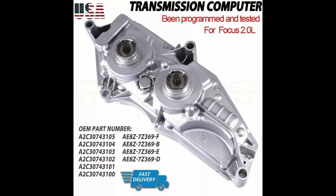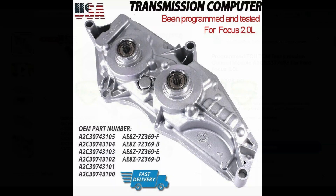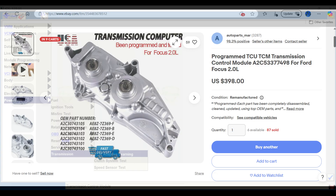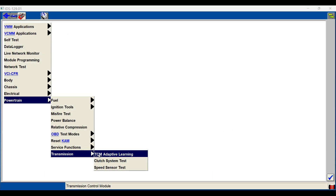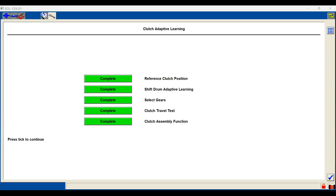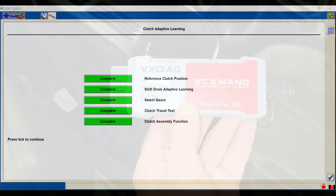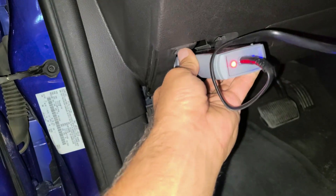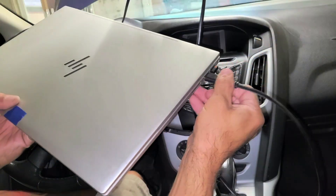To start with, I would recommend purchasing a TCM that has been pre-flashed with Ford Focus software, which will save you a lot of time and headaches. In some applications, you may be able to just purchase one of these TCMs and it might just work as it should after installing it. But with my car, it did not shift correctly until I performed the TCM Adaptive Learning, which is still much easier than performing a complete flash of the Ford Focus software. I will cover how to do this with a lot more depth later in this video.